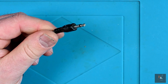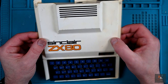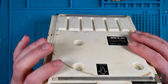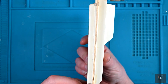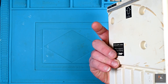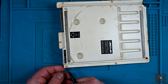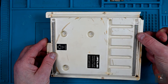With the power supply done, let's bring in the ZX80 itself. As we saw earlier, this has a cheaply moulded plastic case and it's going to be very fragile — it's already cracked in a few small places. There's pressure here from pretty much the heat sink of the voltage regulator, by the looks of it. These are solid plugs that have been pushed through little nylon or plastic split pins, so I'm going to have to gently push each one out. These do not want to come out — this is going to be quite a challenge to do without breaking everything. You can see there's a crack here, here, here, and here. It's seen better days.